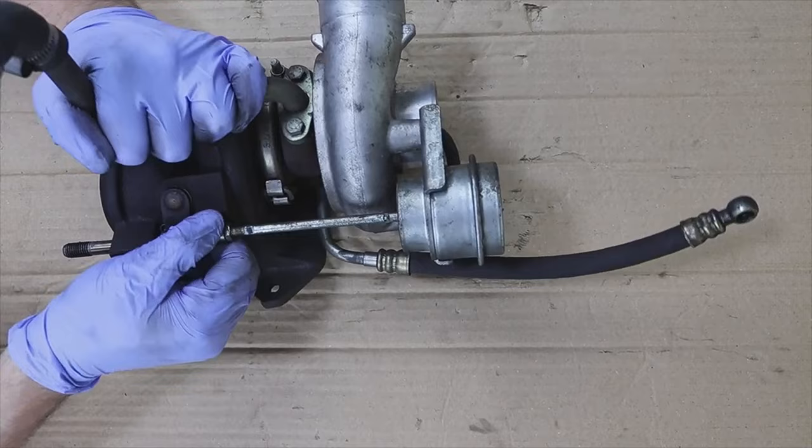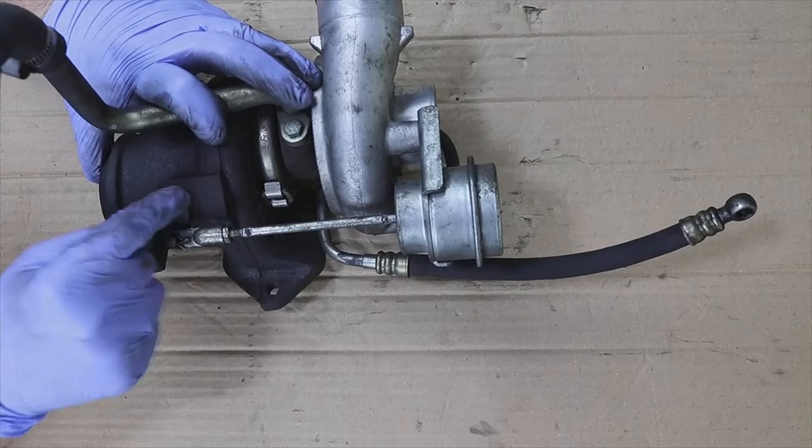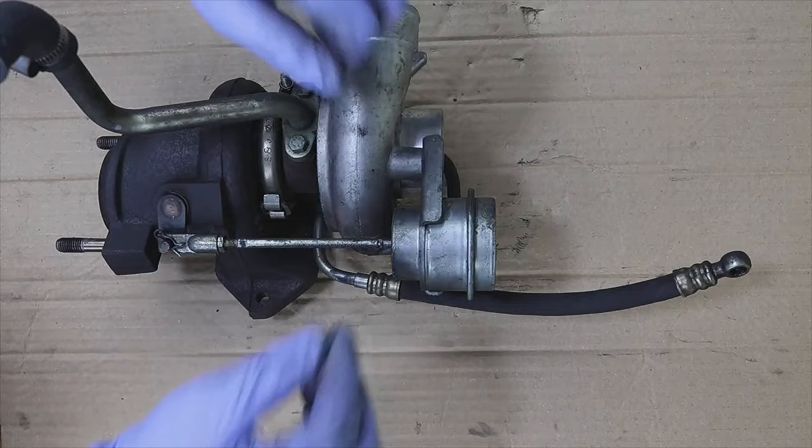This one has a rod, like many other vehicles, because they have another system. But the opening of the gate is the same — you use force, and if you see that you can open it easily, you know that the turbo actuator is failing. This is a very simple test that any of you can do. If you see that the vehicle does not have strength, to discard issues you start looking at this. Then you would also look at the fittings, which would be the inlet tubes to the valve.